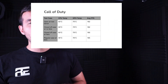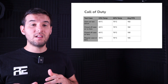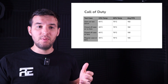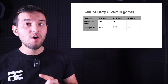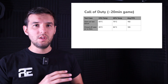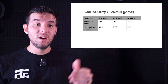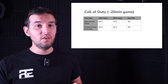On the Call of Duty test, all four configurations were tested for about 10 minutes — one short private match with bots. The closed-off case, whether it had fans or not, was a little bit higher in temperature, but FPS was not really affected. However, when I re-ran the test with a much longer game over 20 minutes, the closed-off case without any fans got significantly warmer — that 10-minute test really wasn't enough to heat-soak it. After 20 minutes, temperatures rose significantly, average FPS dropped by 20 FPS, and it's possible it could have gotten even worse.